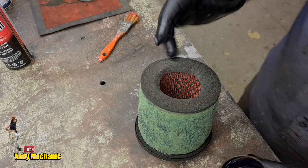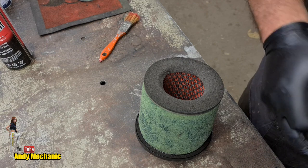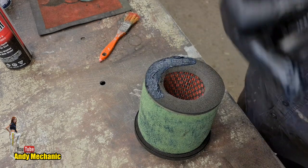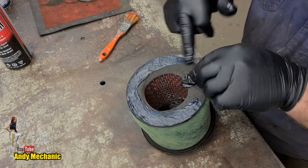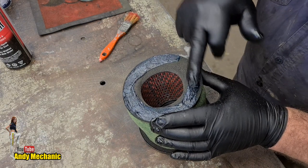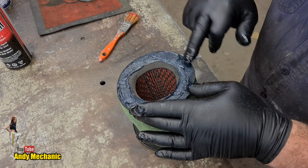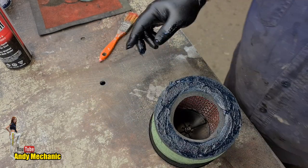All that's left to do is this end of the filter is a sealing surface and it should have grease on it. Given the working conditions for this bike, we're going to use real grease. I have no problems with doing things the old-school way - because you know what, they work. It's surprising how many people don't grease the sealing surface, even on dirt bikes - asking for trouble. Old BSAs and Nortons didn't have any air filters at all, just trumpet intakes straight into the engine. Nothing's getting past that grease.